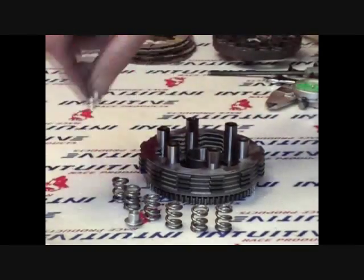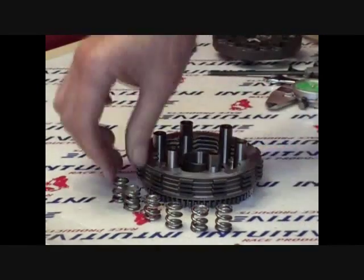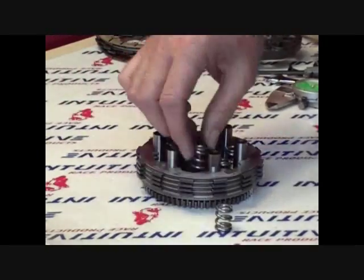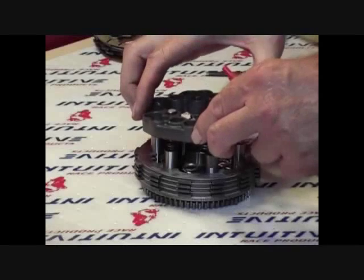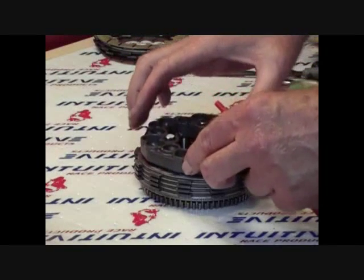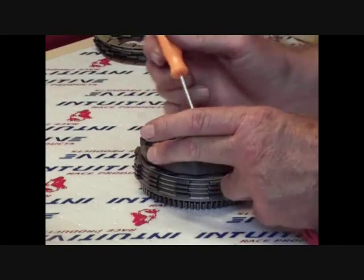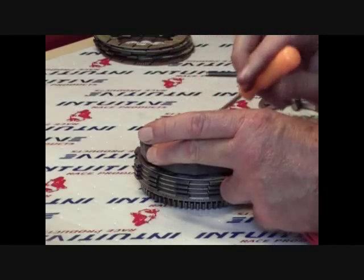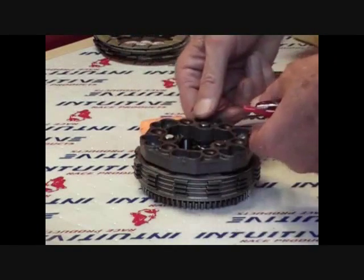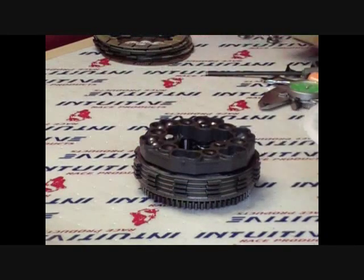Note that there are 2 bolt circles in the holes in the drive plate. Insert the retainers in the holes farther from the center line. Then insert all of the springs. Next, place the ball cage over the fit pins. A probe or a small screwdriver helps move the springs into place. Make sure the fit bolts are almost flush with the top of the ball cage. Next, place the 12 balls into the channels of the ball cage.